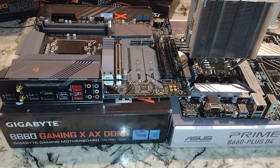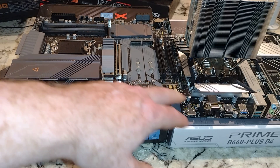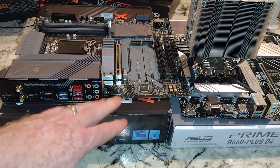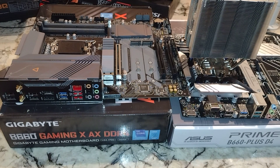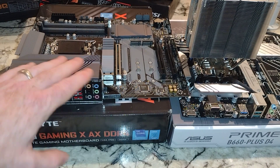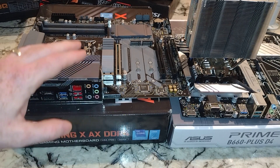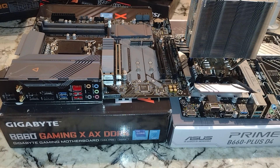There's your comparison between these two. Personally, the Gigabyte is worth at least $20 more to me. A lot of other features are very comparable. Depending on your CPU: for an i3, you might as well go with the Asus. If you hate IO shields, buy the Gigabyte. For an i9-12900 or i9-12900K and you're not going Z690, the Gigabyte is probably the right place to go. Celeron or Pentium? Don't look at either of these — go with a cheaper motherboard. Thanks for checking out the video. Please like and subscribe.